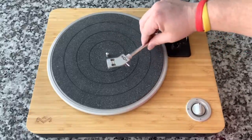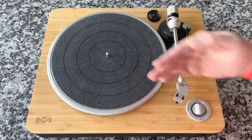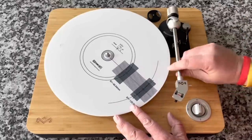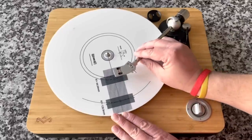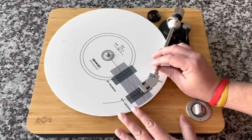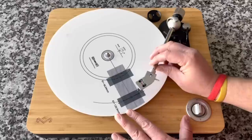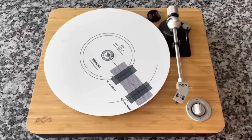As you can imagine, it's curving across. And as such, the angle of that cartridge and stylus in those grooves kind of does this — it's not completely straight. If you put on a protractor, which is used to align a cartridge on a turntable like this, there are only two places where that cartridge is going to track completely accurately. Anywhere in between or beyond those two positions are all going to be skewed — that's called tracking error. It's something inherent in the design of any record player that tracks like this.